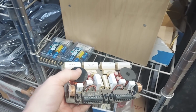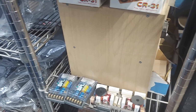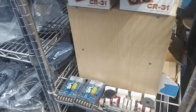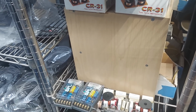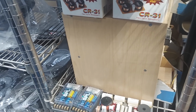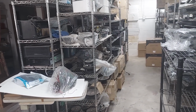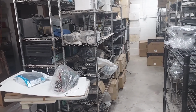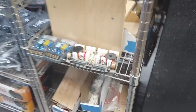So to understand how passive components work in an AC circuit, you got to go back to basic electronics. There are a couple of ways to do it, and you can actually wire all the stuff in series, which I've seen Bose do in a couple of their setups. It's the bookshelf speakers with the 2 tweeters on it, and it uses an 8-inch mid. I know this because I used to do all the repairs for a pinball guy who loved those speakers, mostly because they're durable and can take a lot of abuse. I showed him the only reason they can take that abuse is because they put a light bulb in there as the tweeter protector.